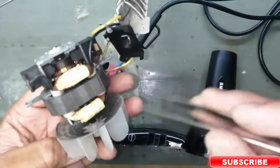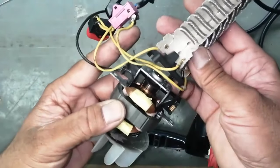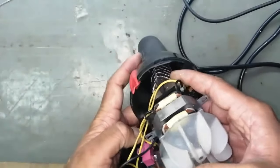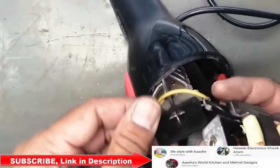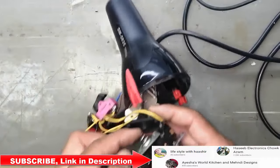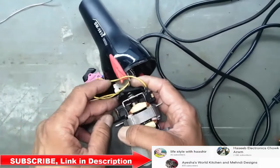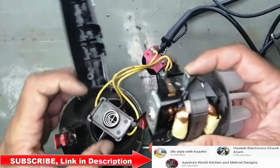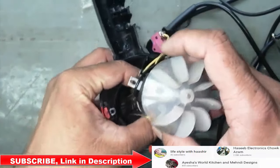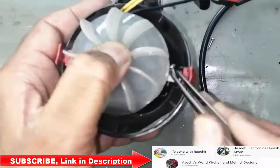Make it clean — if there are some hairs or something, make it clean. Adjust it. Put in this spring. This spring is to protect against vibration of the heating element, because when the blower fan rotates, the heater may vibrate. When we install this spring, it works as a shock absorber.